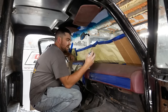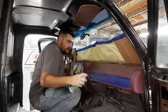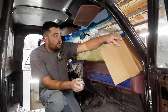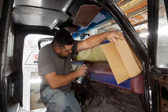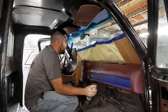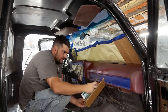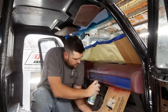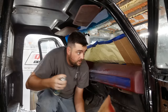The key here is multiple light coats — just kind of dust it. When you're spraying red, whether it's spray paint, vinyl dye, or paint in a car, the more layers you put on, the darker it gets. So obviously we don't want to make it too dark; we're going to have to use a little judgment on how we apply this. It looks pretty damn good. It's the little things like this that can really make the difference. Don't let people say you've got to spend $500 on a dashboard — it's got one crack in it, and that's totally good enough for the quality of this truck.